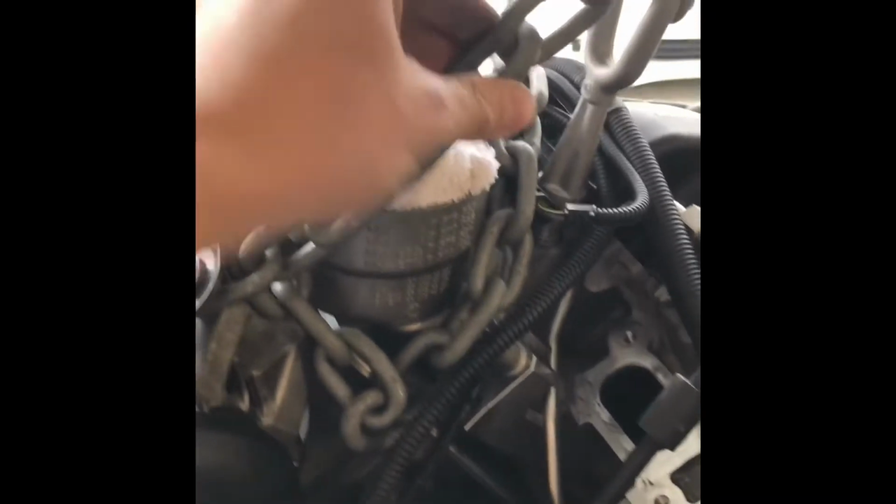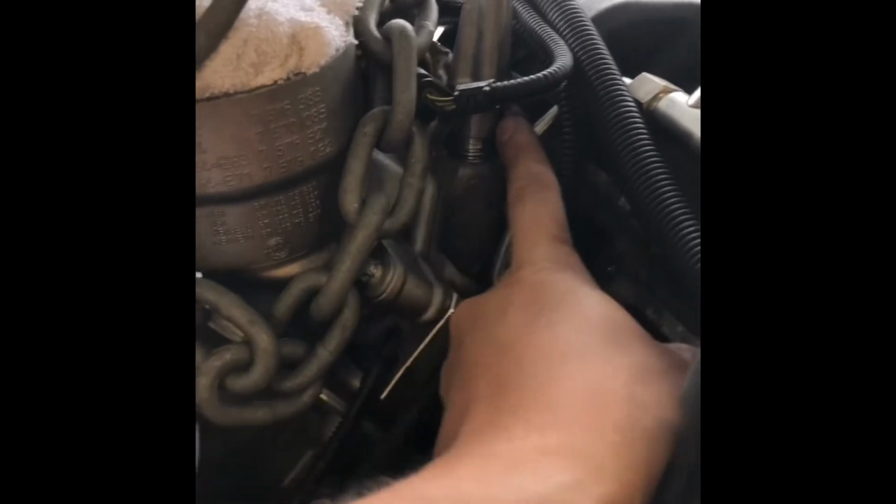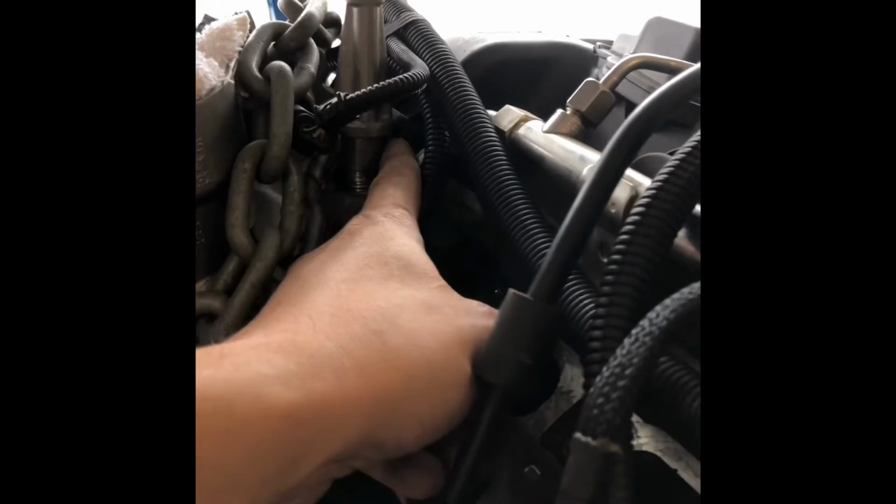And then I did this kind of wonky little thing here where some of my chain hooks up to the tow bolt, and then the rest goes into my bracket for the alternator there. That doesn't have a whole lot of pressure on it. One thing that was weird, when I bought my car, it came with this tow hook, and you would think that that's the one for my car. I don't think so, because it legitimately does not go all the way down. Again, this is an N55. I know N54s have an area machined right there. Mine does not, so if somebody knows anything about it, let me know.